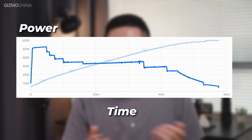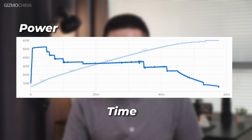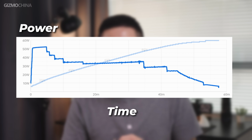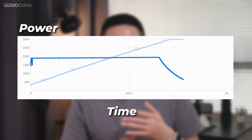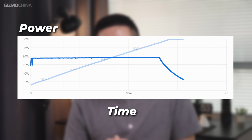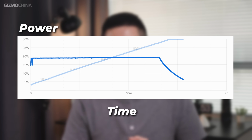If you charge it in a cooler place, say 25 degrees room temperature, it extends the maximum power input to 10 minutes and reaches 80% in 35 minutes, eventually filling up in 58 minutes. But it's a deal that doesn't seem particularly good value. It doesn't charge much faster after all. If you use a third-party charger that only supports the PD protocol, it'll reach 80% after 65 minutes and eventually take 93 minutes to fully charge.